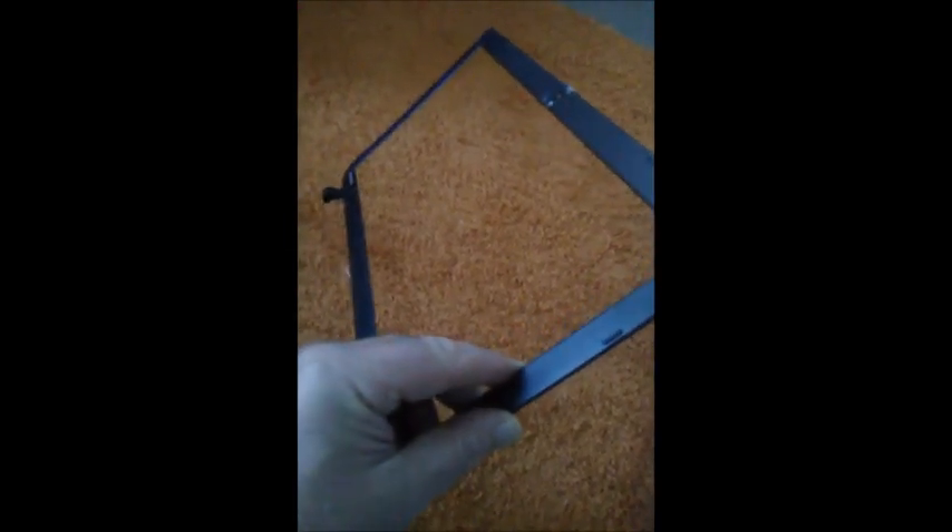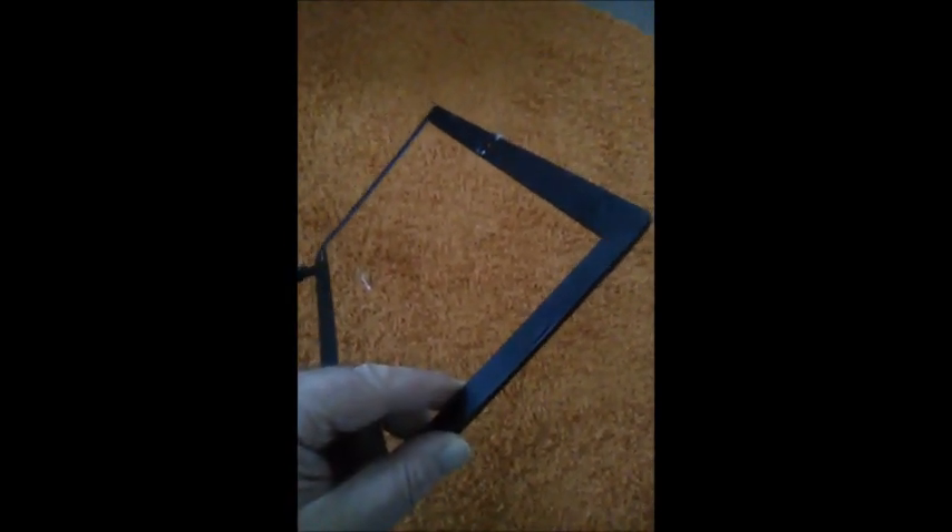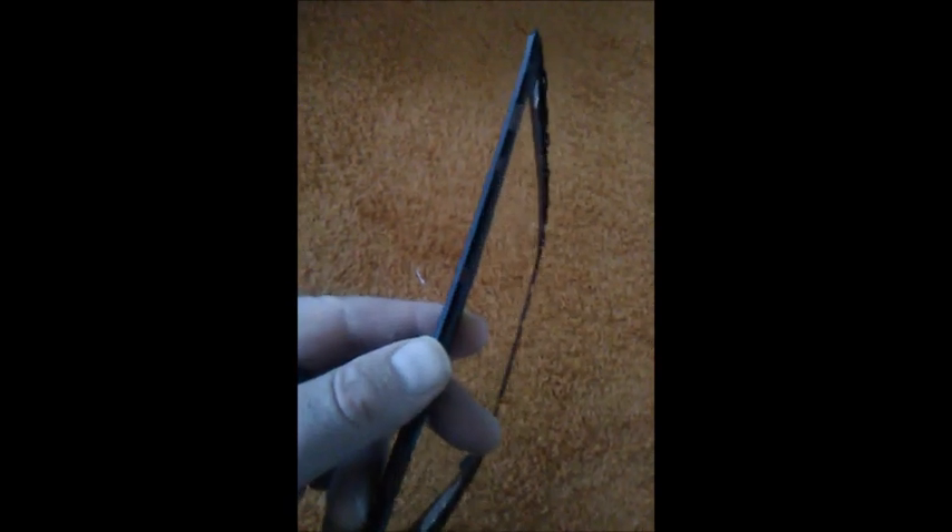This is the plastic front cover cowling that goes on top of the screen, and as you'll see in other videos, you have to get a thin plastic card — like a credit card type card, business card — and pry it off. It's hard to visualize exactly where it attaches, where the seam is, but if you keep trying, you'll be able to fit the card in and pry it. And here's what the edges look like.